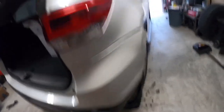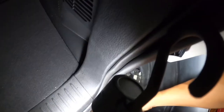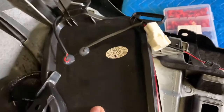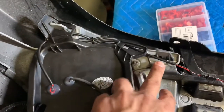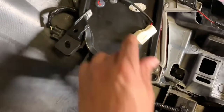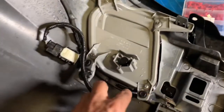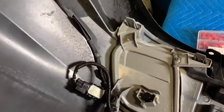On this side, if you have parking sensors, there's going to be a connector on the inside that we need to disconnect. Pull this out and now go ahead and pull off the bumper. Let's get the bumper on the bench here. I can already tell that this is not the same as the factory one. I slipped it in here and it would not reach the other side, but hopefully it will at least bolt up and slip into one of these connectors and hold it in place. First we need to unbolt these two 10mm bolts and then slide it out of those connectors.